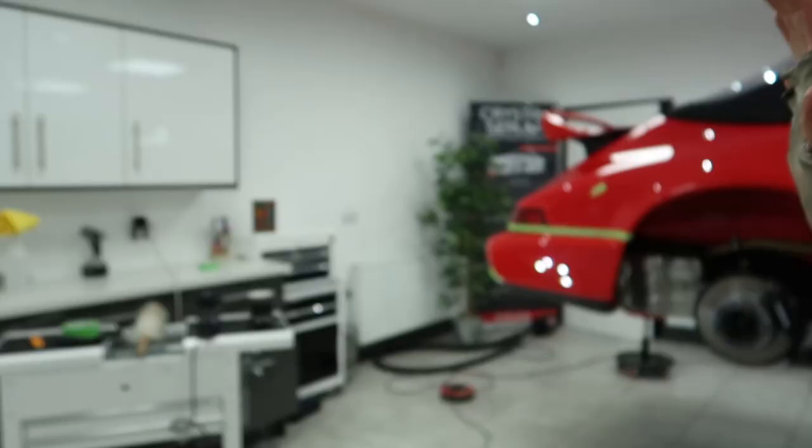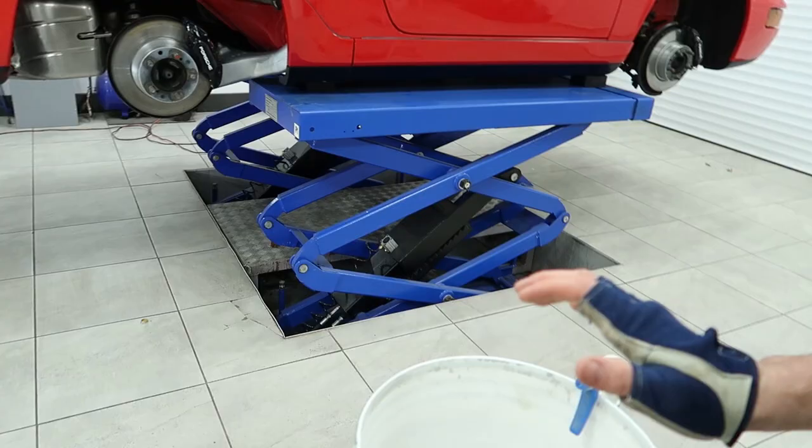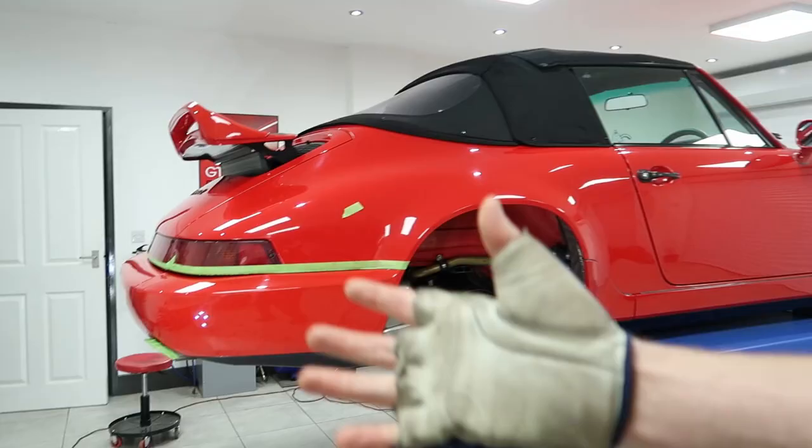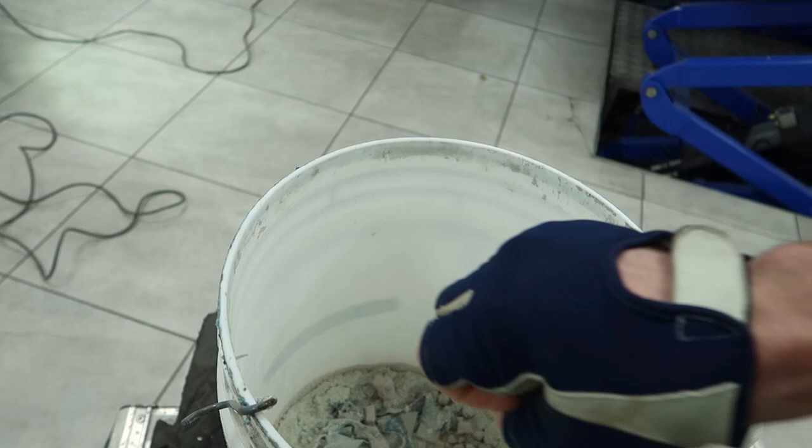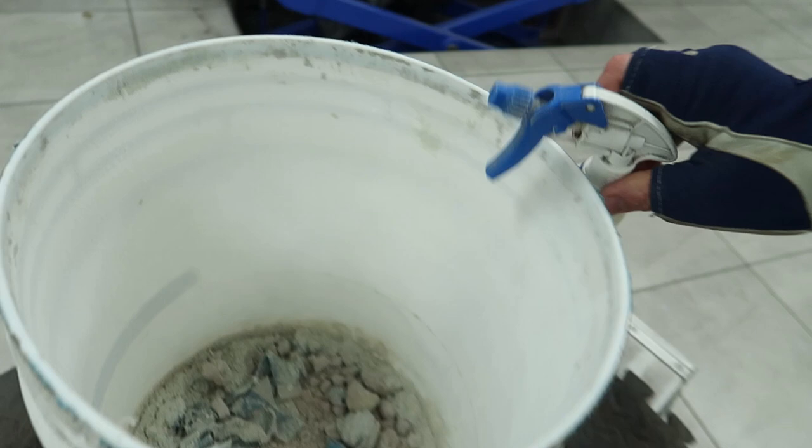For those that missed the earlier vlog, reference residue control. When you're spurring your machine polishing pad, microfibers especially, using an airline fluffs up all the dust into the atmosphere. This is my spurring method: water on the side of the bucket, spur the pad in the bucket, the dust sticks to the wet side. So this is Tuesday morning, start of the polishing process. There's no dust there currently. I'll report back on Friday to show you how much we've captured and how effective this method actually is.